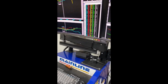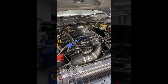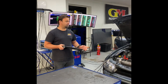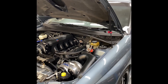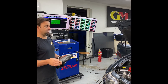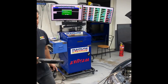We're going to give this car a bit of a run for Glenn — make some power, make some noise. We'll try to do more informative behind-the-scenes videos and give this big Procharger girl a run and see what we can do. Okay guys, just went through some of the data — giving it a final call. It's an F1A-94 on 98 fuel, Edelbrock LS2 in a nice clean VZ. I'm logging with EFI Live and tuning with HP Tuners — EFI Live scanner on the E40 platform has more capabilities for what I need to see.